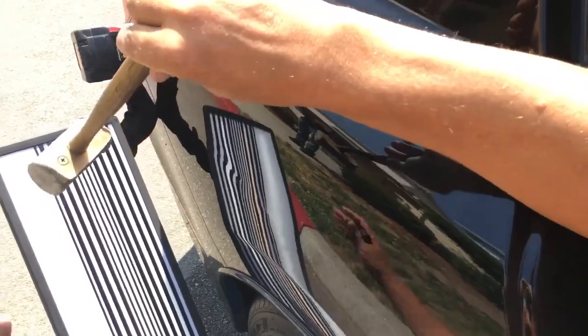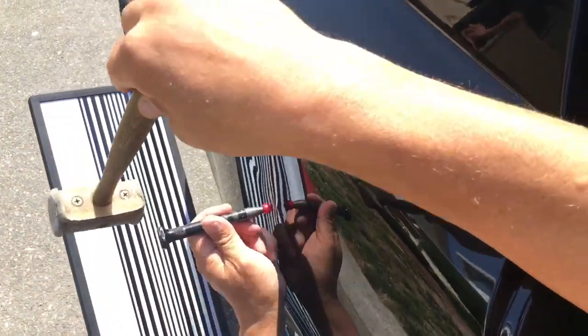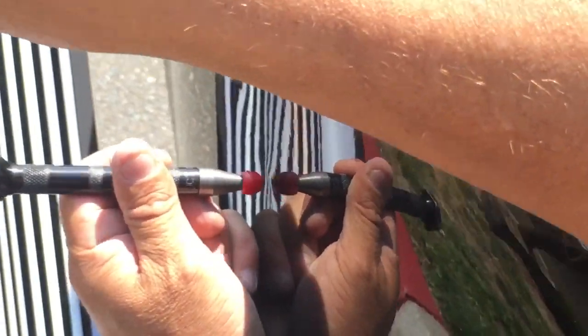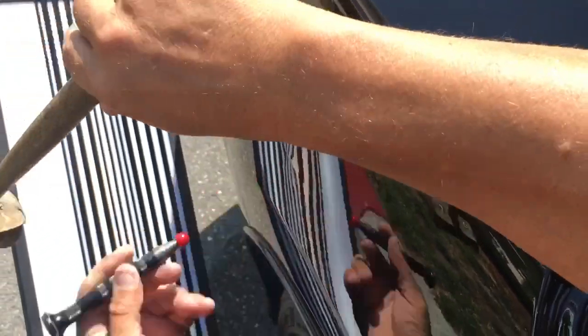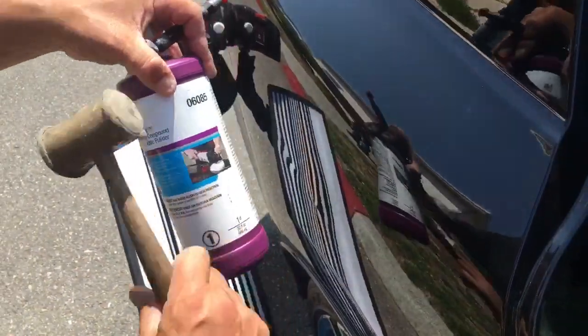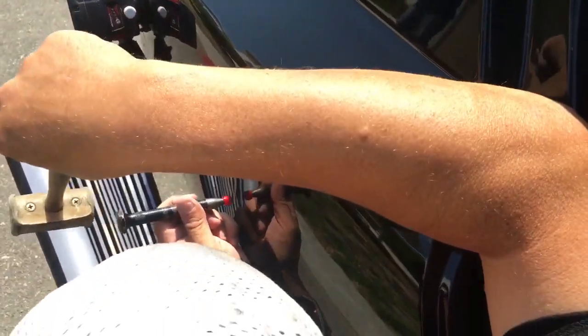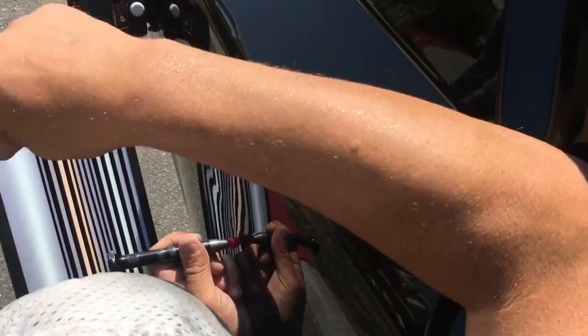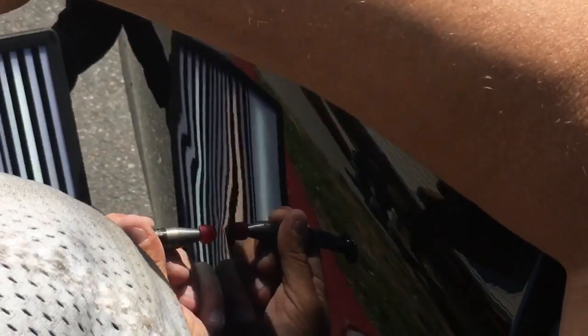There's always going to be scratches there, unless I went out and got the professional power buffer that does the 3,000 RPMs, and you get the 2,000 grit sandpaper. But I personally don't trust myself to use one of these two-handed buffers, just because they burn paint real easy, and that's something you basically have to specialize in. I specialize in dents, and all the buffing I do is usually manual. Sometimes I break out the little 3-inch wheel on the drill, but that's only if something's really needy.